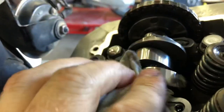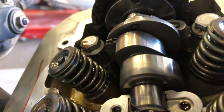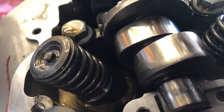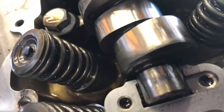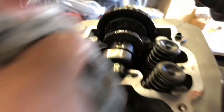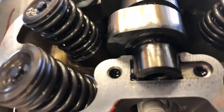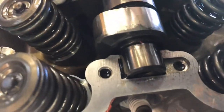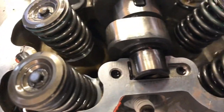Here's the cam — let me get on this side, because that's where the issue I see is. Look at that cam lobe — this is the intake cam lobe and it is worn pretty good. A lot of the surfacing is removed from it. The intake valves were the ones that were loose. Let me see if I can push this motor over while holding the camera. There's a bit of wear through the compression stroke, and there's a bunch of the surfacing removed right there. I'm not certain that this is what our problem is, but that's not good.